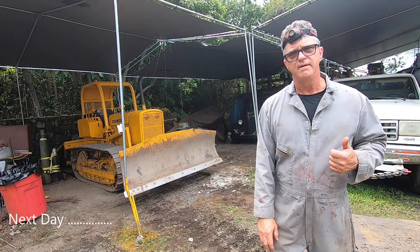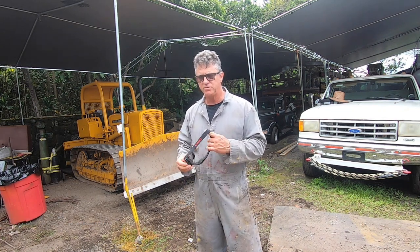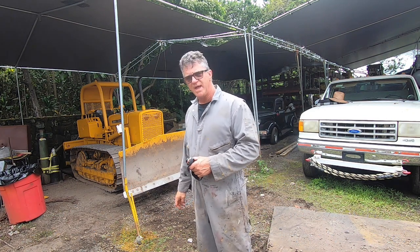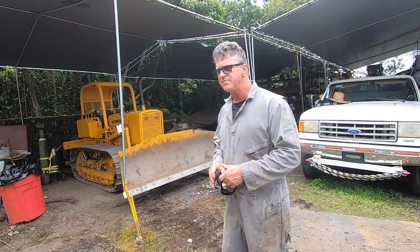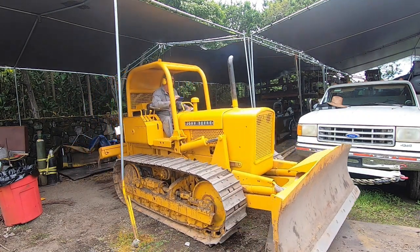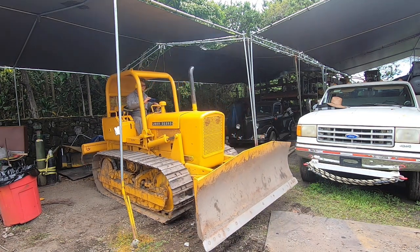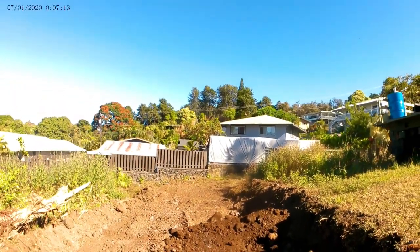So what we did is we adjusted the pressure again. We added two pennies to it and we took out one small washer. It went from 150 to about 168 and it's still not totally engaging very strong. So I'm going to bump it up to about 185, which is where the manual says to go. It is actually catching all three gears but it doesn't seem to be locking in reverse like it should be. I think I'm starting to get it figured out and as I get it figured out I'll try to pass it on to you guys.